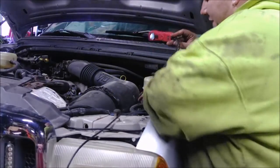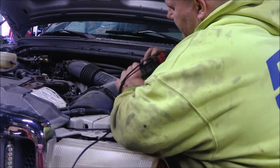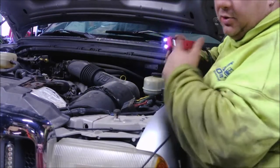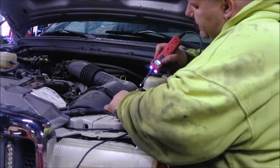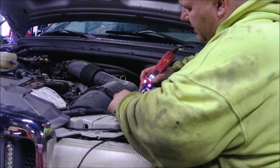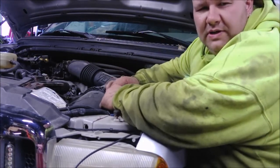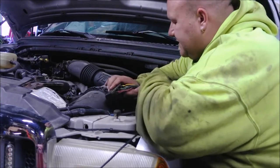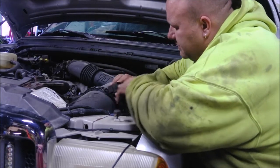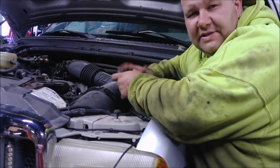We're over here at the relay bank. Here's mine — I don't have it attached, it just kind of sits in there. Three relays, interlocked together with these holders here, pretty nifty actually. I just started poking around with a power probe. I had some power here but I didn't have power coming out of one relay. So I just did the simple thing and swapped two relays. Bam, I had power.